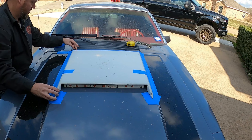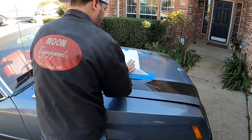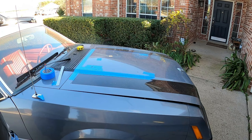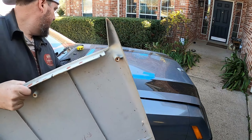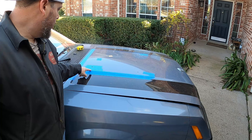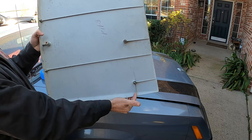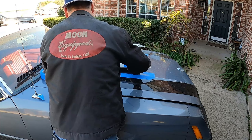Doing the same thing on each side. It's easy to drill the first hole; it's hard to drill the others so they match — that's the key. I've now gotten two drilled: one on the edge and one centered. I've got two studs in. The measurement came out to two and three-eighths out from here to the edge of the scoop and 10/32nds out from the edge in. From here to here was 10/32nds and from here to the outside was two and three-eighths of an inch. That ended up working out perfectly.